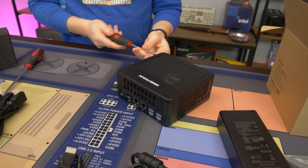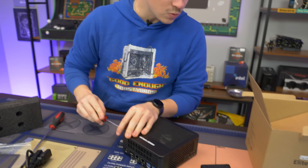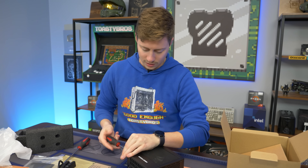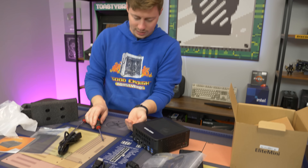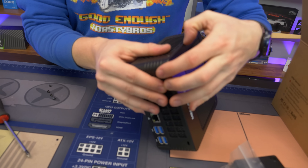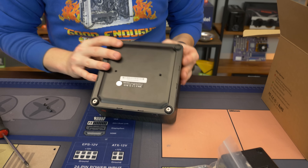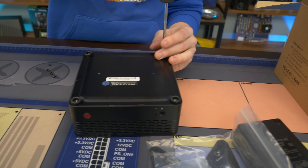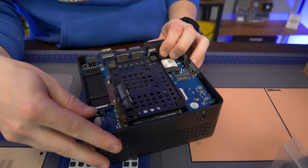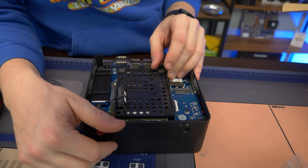They're pretty user friendly, mainly because they know people want to add storage, so they often have storage expansion options. We actually do have a 2.5-inch SATA ready to go — literally you just plop the drive in and plug it in. Here's our NVMe SSD with a big heat sink. There's actually a second socket here for a shorter M.2, like a Wi-Fi style one, so you could do more storage or add a Bluetooth module. It has two sticks of RAM, 16 gigs total.